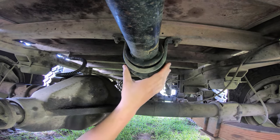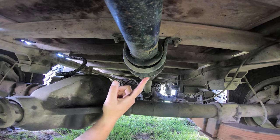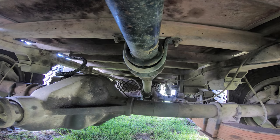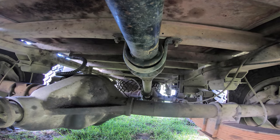That will definitely have been where my vibrations have been coming from. All my other shafts I've checked seem to be quite firm with no play. I'll probably hit some of them with a grease gun while I'm under here as well. We certainly need to take this one off and that's going to be slow because I don't have the correct tool for these flange bolts, and it means I'll have to roll it backwards and forwards to get the flange to the right position.